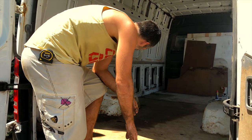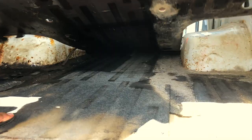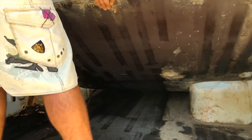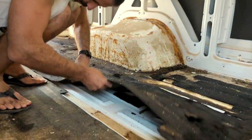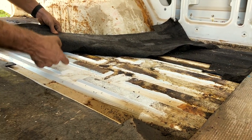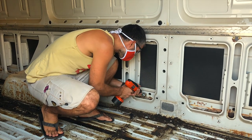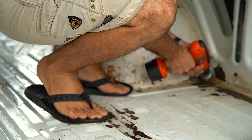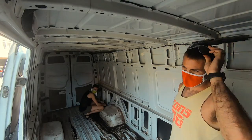There's a little bit of rust throughout the van but nothing really major. The floor has been a big thing we've been wondering about since we bought it, so let's see how she is underneath. It looks decently good — it looks like they've protected the flooring, so there doesn't seem to be rust. There is oil from where there was a leak, but the oil actually protects the paint. The ground looks good — no holes. Most of it is just surface rust, so we're using a drill bit and some steel wool to scrape it off so that when we apply our anti-rusting coating it will protect from further oxidation.